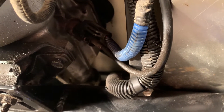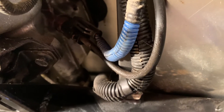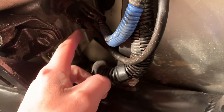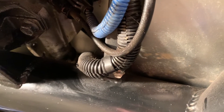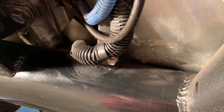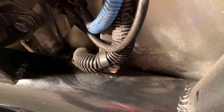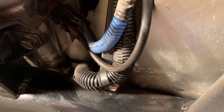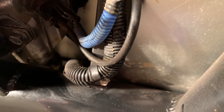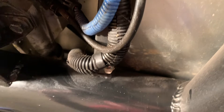Here's a better angle of the speedo cable leak I was talking about. It appears to be coming down from where the cable goes into the actual sensor housing — that seems to be a common problem with these. I had it on my V8 Miata that had this same drivetrain and it did the same thing. I ended up having to reseal it, so I'll pull that apart and get that taken care of, because every time you run the thing it starts to drip.